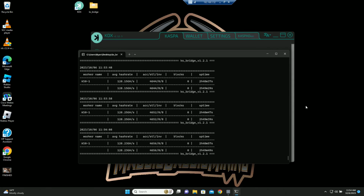Also, that wattage includes 5 watts for my external USB fan. So really, we're looking at about 80 watts. So for those of you who are wanting to upgrade minimally like that, and you're worried about your power supply and what power supply should you use, I would still, again, highly suggest against using the 90 watt if that's what you have. If you have the 120 watt power supply, then yes, that one would be okay to use. You are still within the 80% rule.